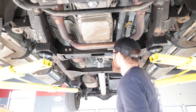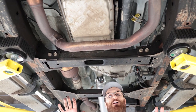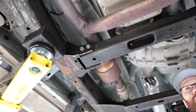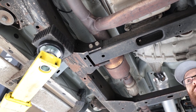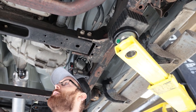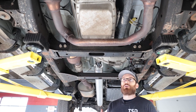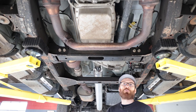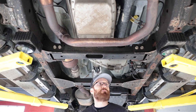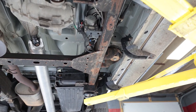Moving back, some of these areas are still holding up pretty well. Honestly, if you get under your truck before you have a lot of corrosion, you can just do oil sprays — either regular used oil, which a lot of guys do though it's not as environmentally friendly, or the lanolin spray which is more environmentally friendly. As long as you keep it lubricated over winter where salt and dirt can't stick to the frame, it won't ever corrode. If you have a truck that's only a few years old, just start spraying it and it should last. A lot of guys using Kent Automotive said they've sprayed their trucks for years with no issues.